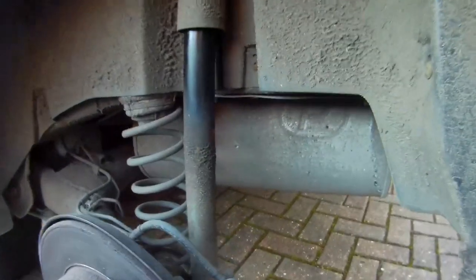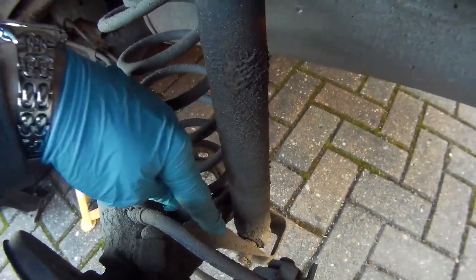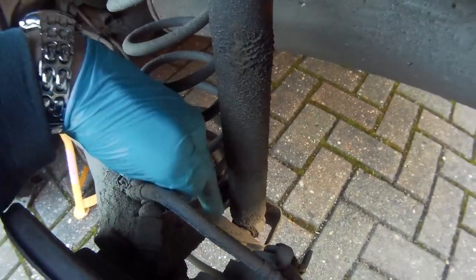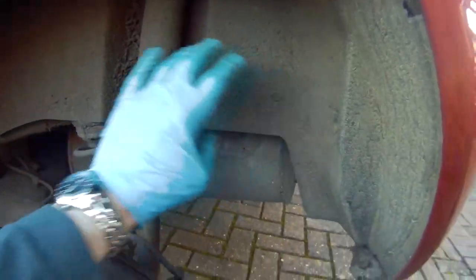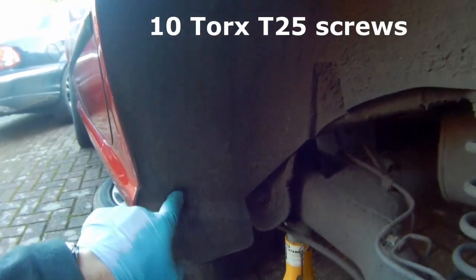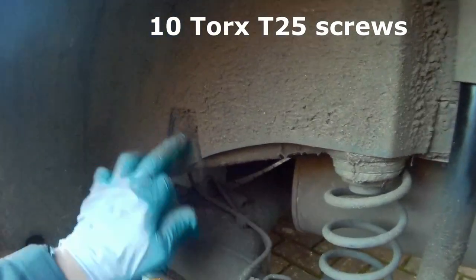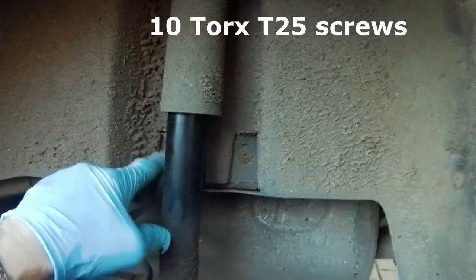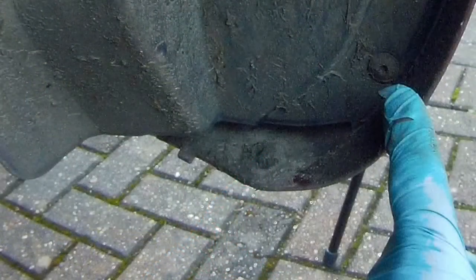To get the strut off, it's located at the bottom — a straightforward bolt, I think it's something like a 17 or 19, I'll have a look when I get to it. To take the top part of the suspension strut off, we can't get at it because of this inner cover, so this has to come off first. It's attached by some T25 screws. There's one in there, one there, two there, one here, one here, one here, and one here.